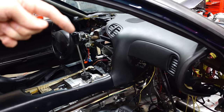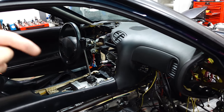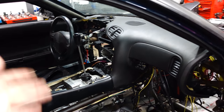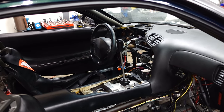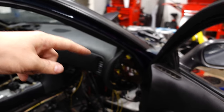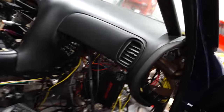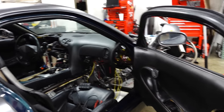That's more like the running mode — I want to use that for scene points, but that doesn't affect slamming on the brakes. On the front end, I actually ordered a pressure switch that turns to ground as soon as brake pressure hits 20 psi. I was going to have a physical switch but a pressure switch is going to be easier. The pressure switch will go to the PDM under here, so the power system will light the brakes. I have four circuits: brakes, running lights, left turn signal, and right turn signal — and running lights and turn signals also go to the front of the car.